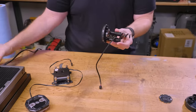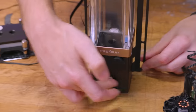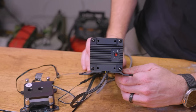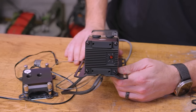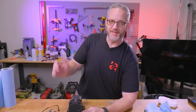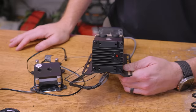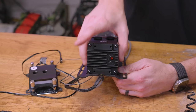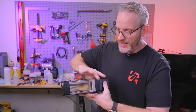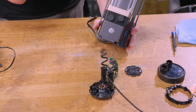Next, let's move on to pumps. This little AIO pump obviously doesn't hold a candle to this standalone pump combo, which is also extremely expensive at around $300 and something. This bottom portion is actually the pump — it contains a D5 inside. It's manually adjustable, not a PWM pump. I personally don't like PWM pumps because I can't control the speed when I'm trying to fill and bleed a system. When filling, I want maximum speed. When bleeding, I like to vary speed up and down because that motion of high and low pressure helps jostle bubbles loose. Some PWM pumps go low speed if they don't see a PWM signal, which is a problem when bleeding.